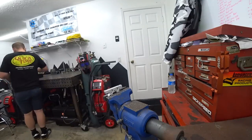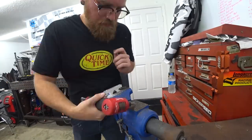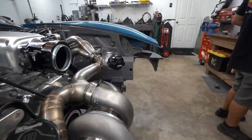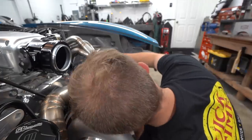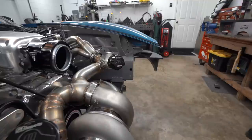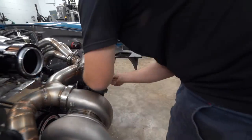The oil filter housing bracket is threaded for bolting from the back side, but we need to bolt it the other way into rivet nuts on the frame rail. So we broke out the carbide burr on the die grinder — essentially hand-milling — to make the holes big enough and slot them so we can get bolts in from the other side. After a lot of man-milling, we got it to work and mounted our rivet nuts. Same process as before — one rivet nut first, bolt everything up, then mark and drill the second so spacing is perfect. The downpipe ended up being in the way of the drill, so we had to pull it out.